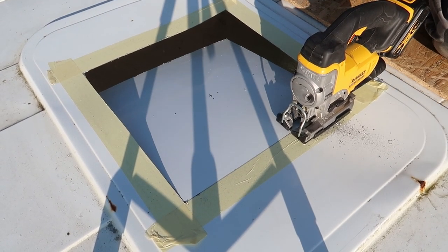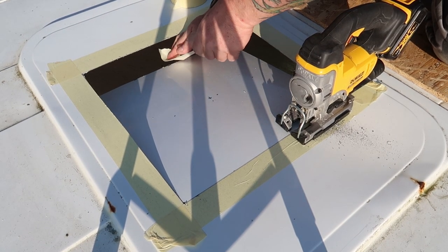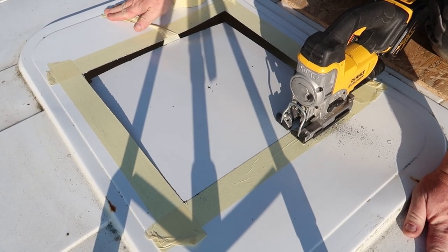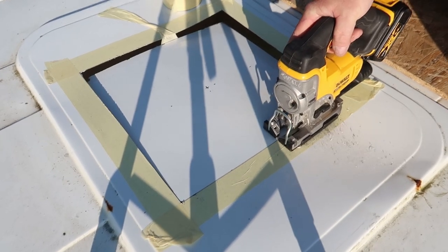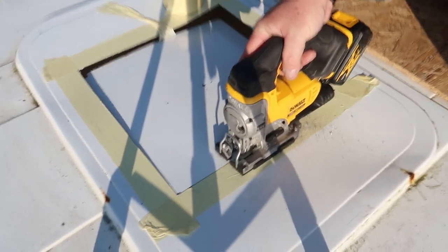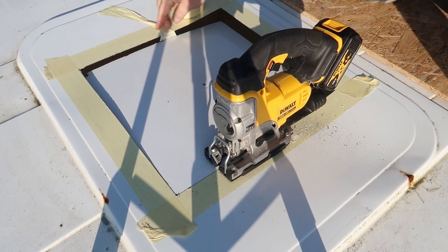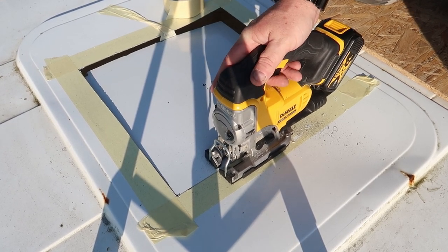Right, a little tip for you. Get some tape. Tape it round the underside of the flat. Spin the tape round and then tape it to there. So that side is now held up. A lot of people will try and tape that from the inside. I never bother. That's the fastest way I'll get to hold that side up, to stop it dropping and snagging the jigsaw blade.